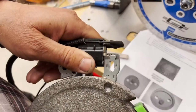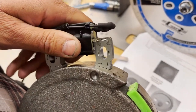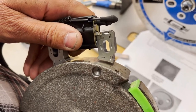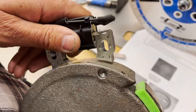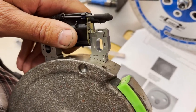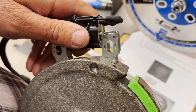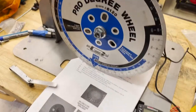And you can fine tune this off of the flywheel, but by the rules, you can't go higher than 35 thousandths. But I could go 3 thousandths if I wanted. Correct. There's no minimum. But sometimes the flywheels aren't machined exactly perfect, and the flywheel will rub when you spin it if you get it too close. But it won't hurt anything. It'll just rub until it wears a mark in it and it wears itself in. Okay, so let's move on to one other topic.